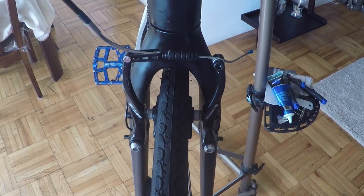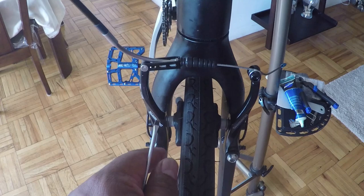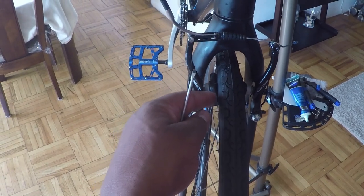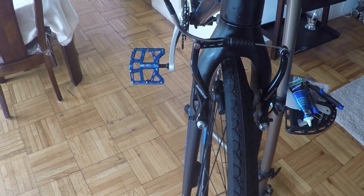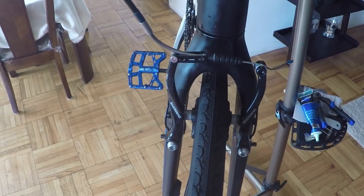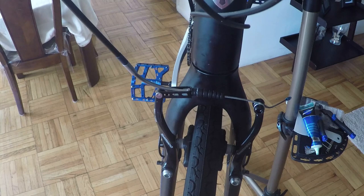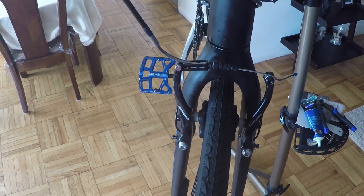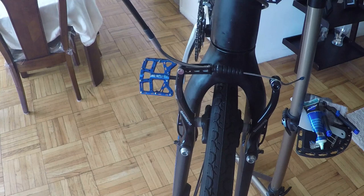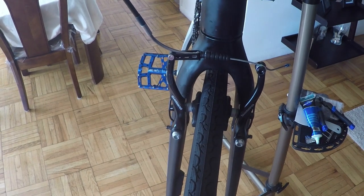You can notice that the movement is pretty even at this point. The movement is pretty even now — I've made maybe a quarter turn and that's about perfect. It's taken in the quarter-inch space that was on the right side and it's pretty even with the left side. Both brake pads are striking the rim evenly and they're not touching the tires at all. So that's how you replace your linear V-brakes on your bike. I hope you found this tutorial helpful. If you have any questions or comments, please enter them in the comment section below. Please like and share. You can also subscribe by clicking on the link in the bottom right-hand corner of your screen. Thank you for watching.